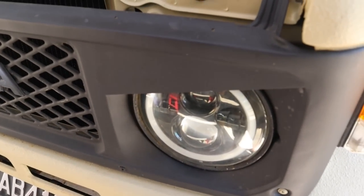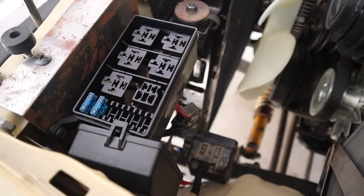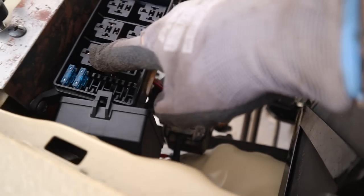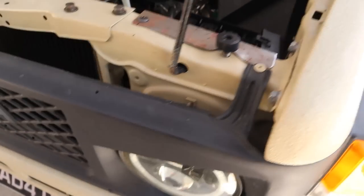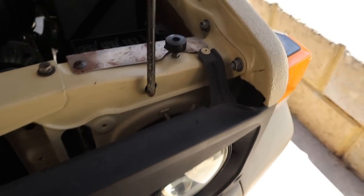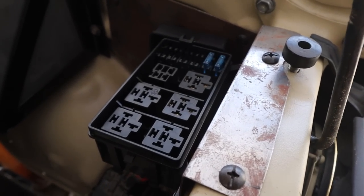these LED lights. And Toyota uses a negative switching ground to actually turn on the headlight. So you have to run two relays, a low beam and a high beam, to actually switch it to positively switched. And if you're interested in that, I'll chuck a clearly readable diagram in the description. But yeah, I'm just going through and wiring up the headlights.